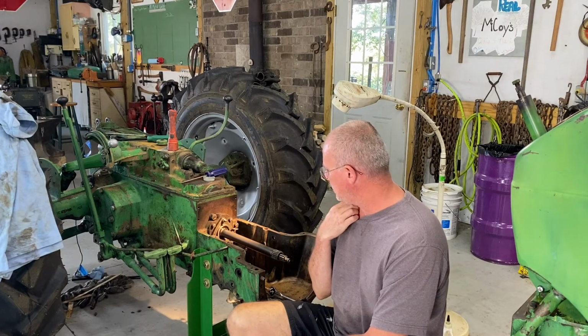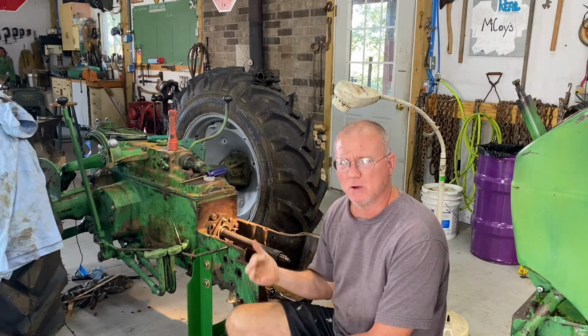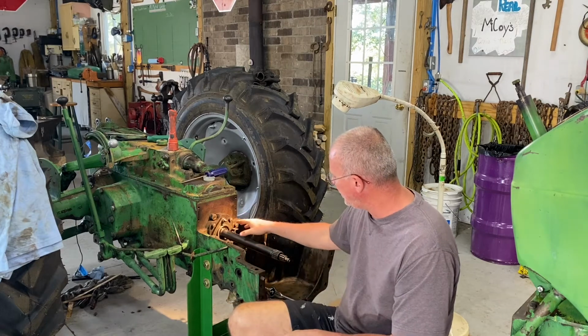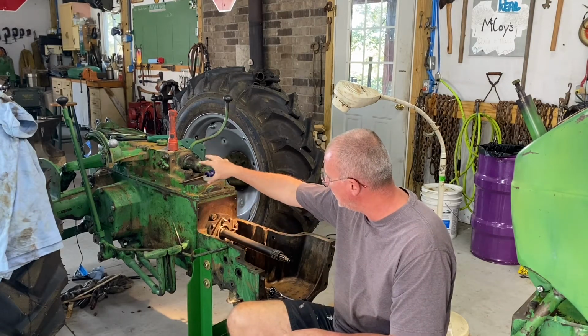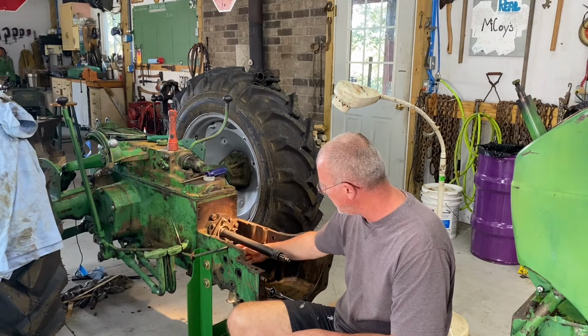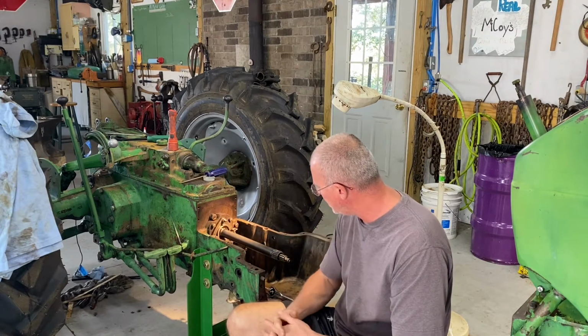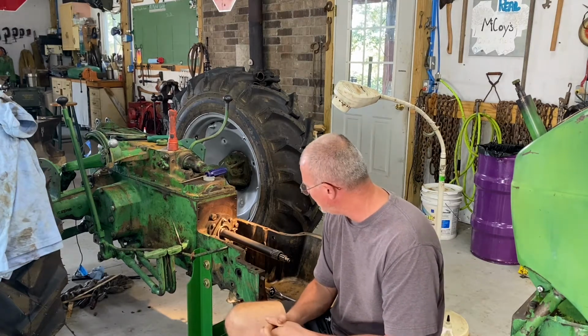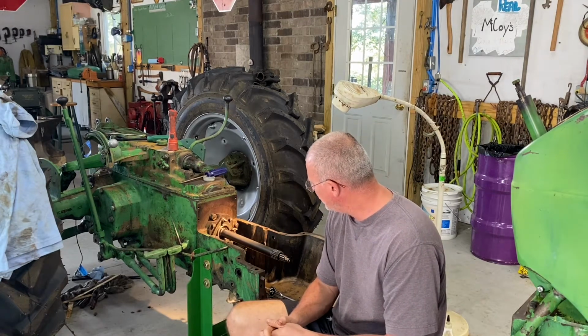We're gonna start reassembly of the PTO clutch today. Actually it's this evening. I've just finished putting in a bunch of seals for the PTO in the rear, this shaft in the front, as well as the lower shaft in the front here. And so we've got new seals, new O-rings, everything's pretty much new and went together really nice.